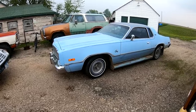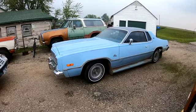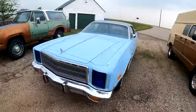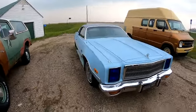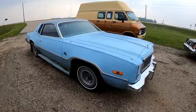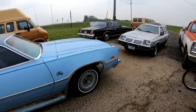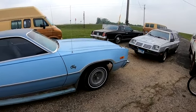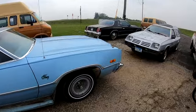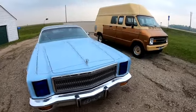I had to do several adjustments to finalize the ride height. After putting it in I set it a little higher than before, drove a mile and a half out and back, and it dropped an inch and a half - cranked it back up. Drove into town and back, about 30 miles, and it lost another inch-plus - tightened it again. Went into town another 30 miles and it only dropped about a quarter inch, so I think it's settled. I still need to get a wheel alignment - it drives straight and doesn't pull, but I don't want to burn up good tires.